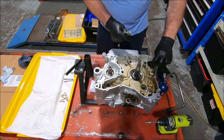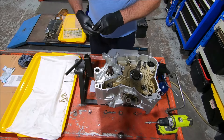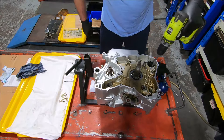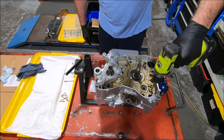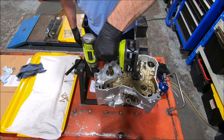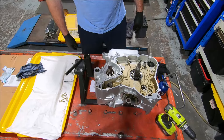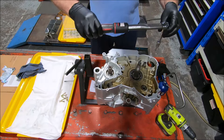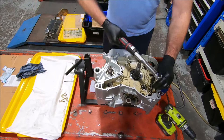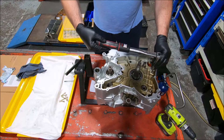On these there are three internal screws from this side and two external. You should see some of the sealant sort of come out the sides when you put those bolts in. We'll torque those up to 25 Nm. Once we've got these ones tight, I'll spin it over and do the ones on the other side.